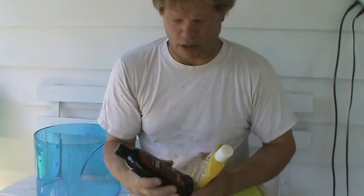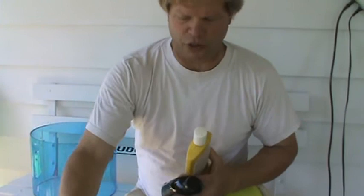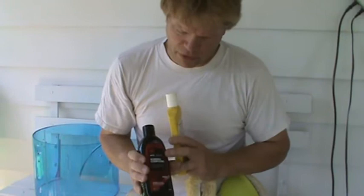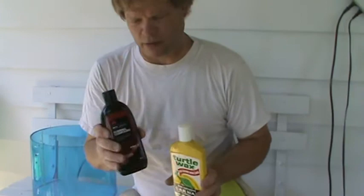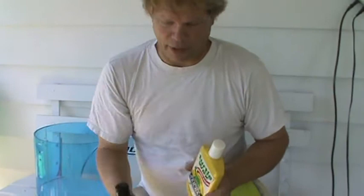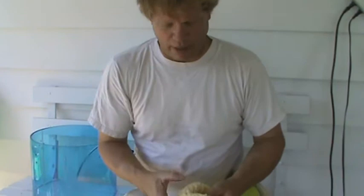I just got back from Napa — they didn't carry that anymore, so I bought this. It's silicone-free, just as the first bottle. What I do is I mix this 50-50: it's 3M Auto Advanced Rubbing Compound — I paid $12 for this bottle — mixed 50% to 50% with Turtle Wax. And I use the wool bonnet, so I get mirror results out of this.